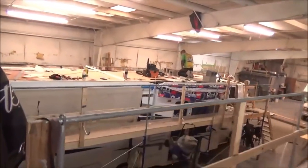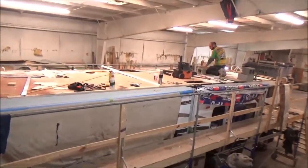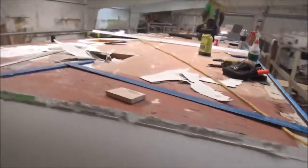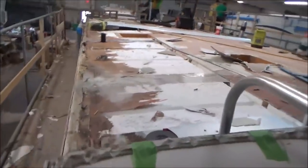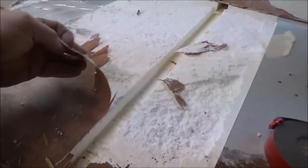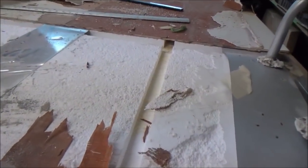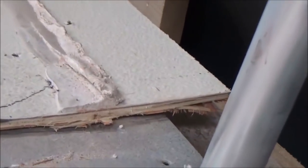Just real quick to show you some of the issues — this is a 2014 right here that we got. It was bought brand new and we're redoing the whole deck on this one. You can see all of this has got all delaminated — this is the lamination as it comes apart. It had a fiberglass roof on it so we'll be putting this one up too. You can see some of the fiberglass right there — that's the acrylic of the roof. Then it's just got the luan that gets glued down. That'll give you an idea — you can watch that video probably in a couple of weeks by the time we put it all together.